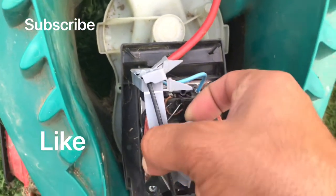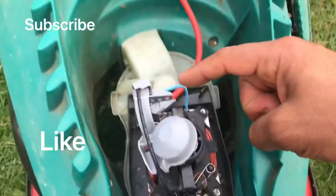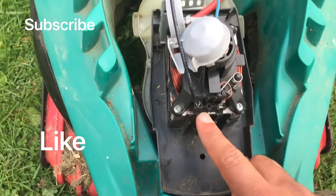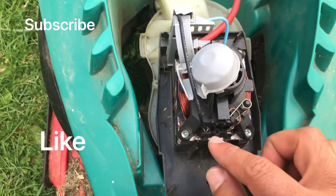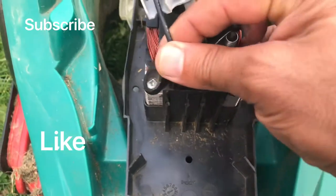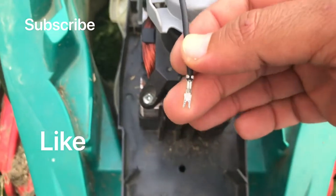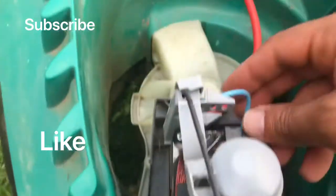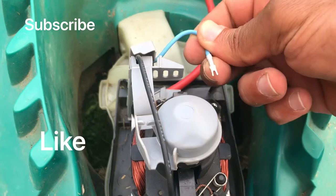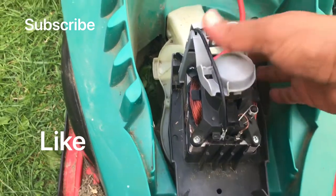Click the clip off and it will come off. Then you've got two wires: one blue at the back and the black one in the front. You might have different colors, so make sure you mark which one goes where. To get them off, just fiddle with them — pull up and they come off; they look like a fork. Same for the back one: pull it up and it comes off.